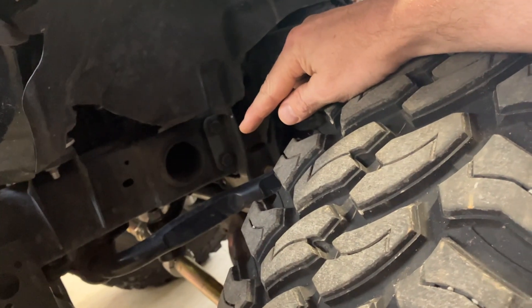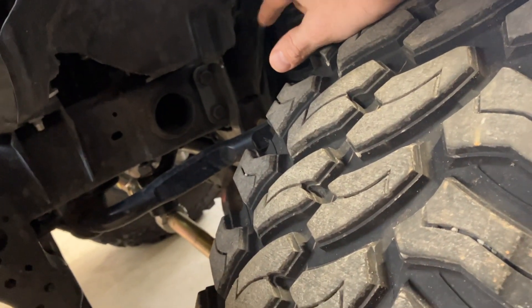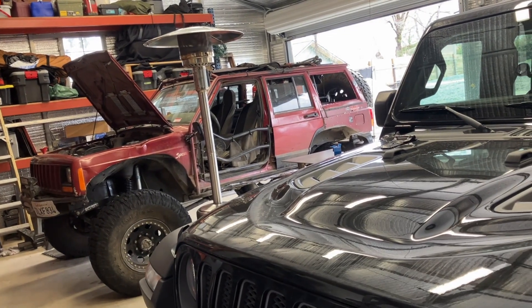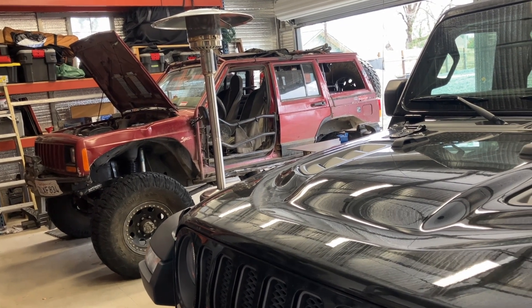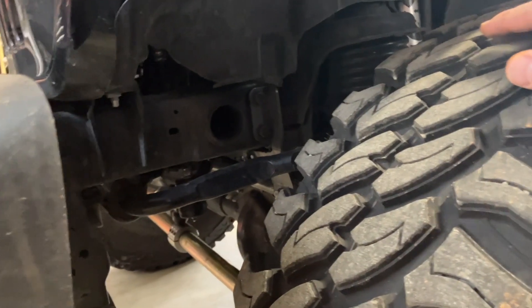They all do that - that's just factory. I've talked to mechanical engineers who say it shouldn't. If the frame is engineered to flex by stiffening up, it could be a problem. XJs are unibody and they flex like crazy. We plate the whole thing front to back and it makes a huge difference - instantly drives straighter. Without the plating you're ripping track bar mounts off and you're ripping steering boxes off. I still think regardless of whether it was engineered to flex or not, the plating is going to come soon enough.